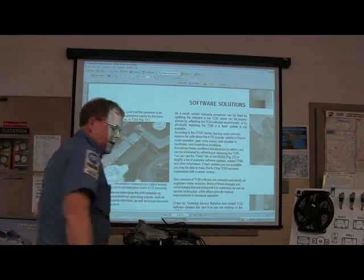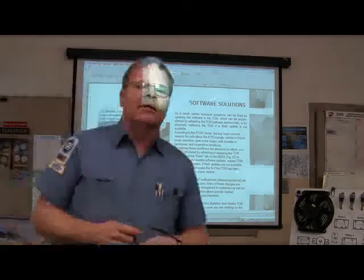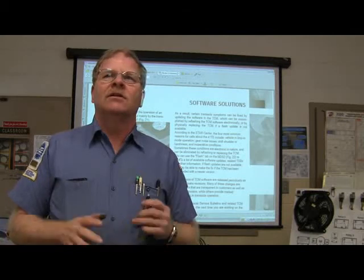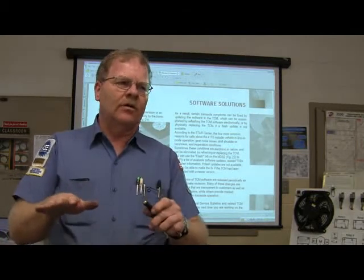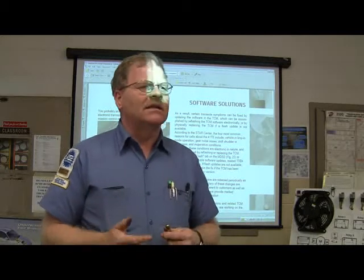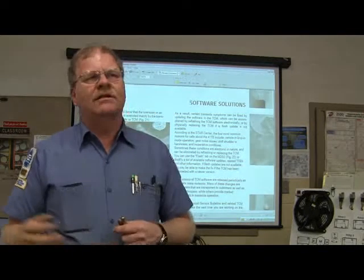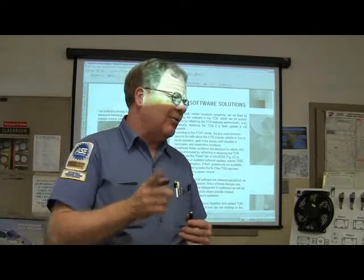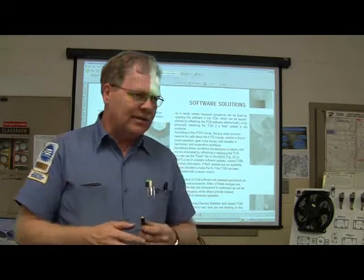We've done that. Now, one time, whenever I was working at the dealership, there was this Dodge truck that had a diesel in it, and the automatic transmission was hunting in and out of fourth gear going down the road. And there was a guy going to buy it. He said, "I'll buy this truck if you can fix this." So we were swamped in the shop, so they took it over to a transmission shop, and they said, put a throttle position sensor on it, which it had one, even though it was a diesel, because it had an electronic transmission.